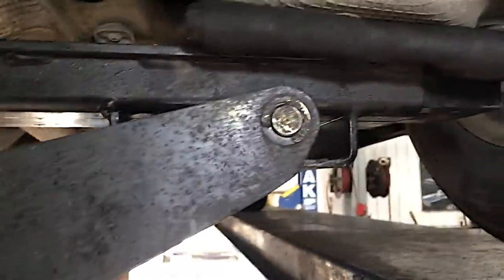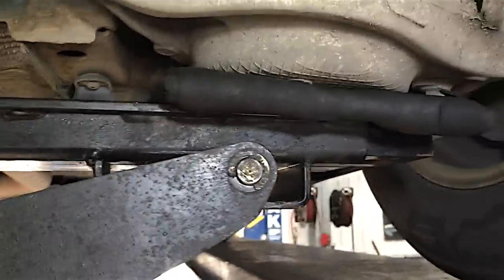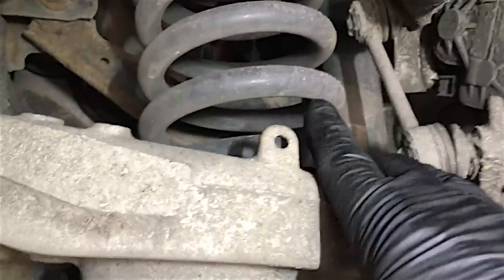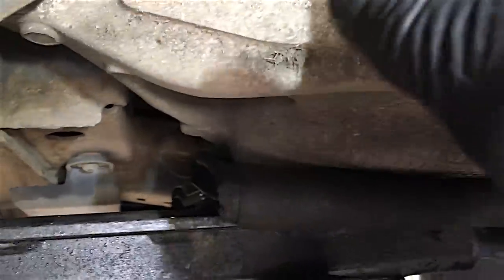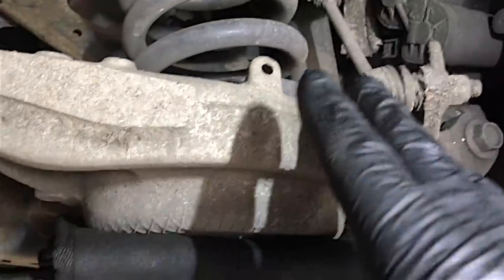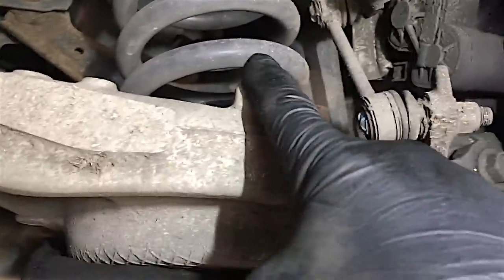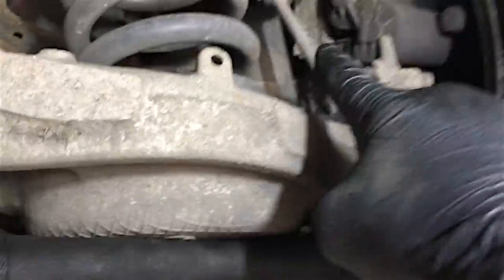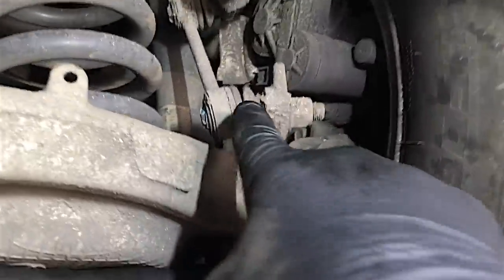With the back wheels raised up, notice I've jacked them up on the bottom suspension arms. It's just this particular type of ramp, although you can jack these up on the sills. Anyway, the rear springs, you'll just go over looking around anything you can see. I will point out, I've never had a broken spring on one of these at the back, nor on the front, come to think of it. The anti-roll bar drop links, I've already covered them. They don't tend to get knocked out either.